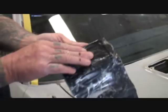And then I'll be able to get all these edges and nice contour sanding as we proceed, you might say, to sand our car. Right. You don't want to sand the whole car with this block. Do you know why? Because it's got a lot of flat surfaces. This is a semi-square car. So you want to use this block and this block in conjunction, see?